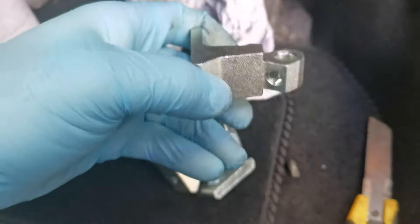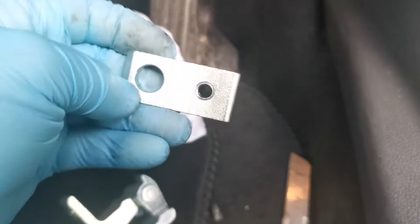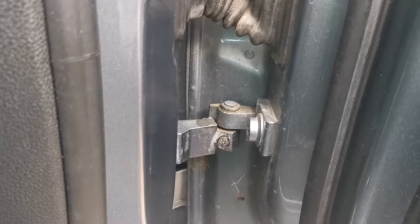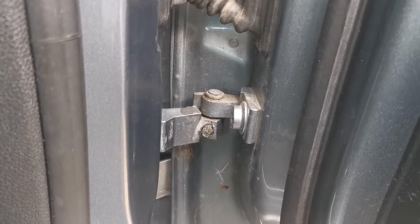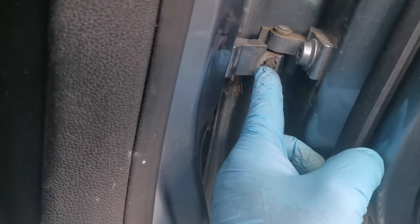The top one I've already replaced. There are two bolts on the inside — the one from the outside is obvious, you can see that behind the hinge, but the other one is from the inside. The bottom one isn't a problem if you need to replace it, but on the top one you'd have to remove part of the dashboard to get in there. So to make the job far easier, we just unbolt the bottom bolt here and do the grub screw there.